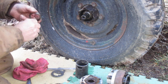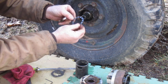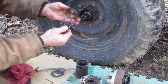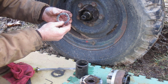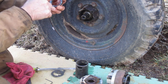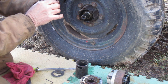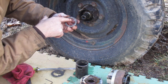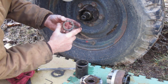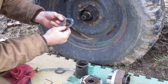You're probably not going to be able to see it, but there's just a little nub coming up here. What that does is it locks into the spindle so this can't turn. With this can't turn, then that nut in there can't turn out. Then this goes in and locks this so this one can't turn. All that little Allen nub does is come through here to sit into one of these holes. You can usually get two in — there's one, two, and there's another one over here. That's why you've got three of them and only two usually come into play. And then that keeps that nut from backing out. Because I'm putting this back on, this is the part that secures it on the spindle so it can't spin.